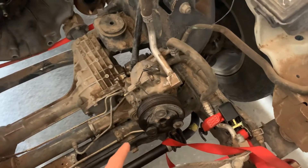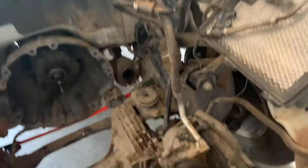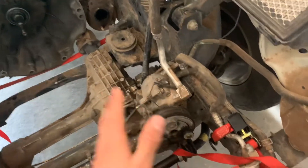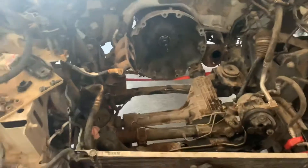You're going to want to take off the AC compressor — that'll make it so you can remove the engine without having to disconnect all kinds of lines. Just unbolt it from the block and move it away. Same with the power steering pump, just move that out of the way. That's pretty much it for the front and the top of the engine.